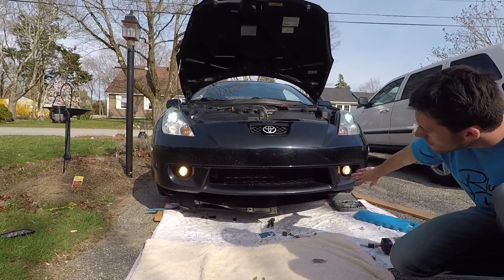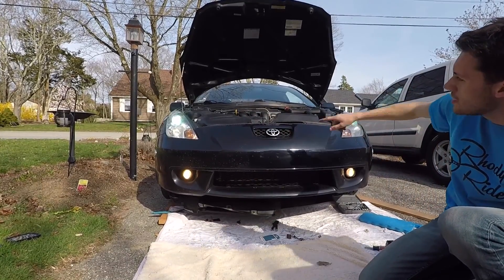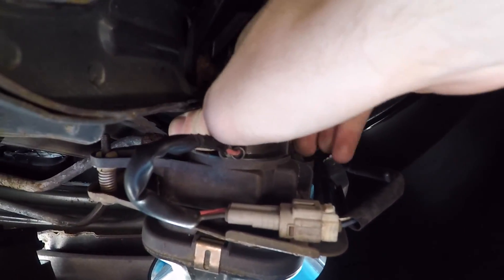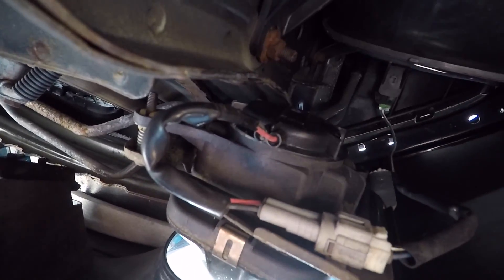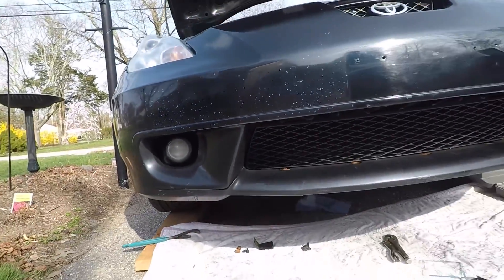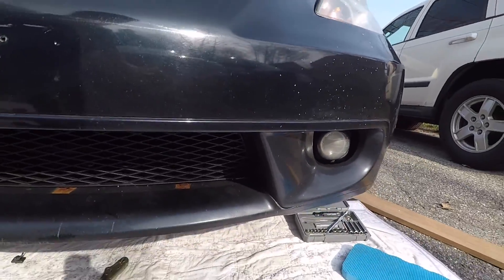You can see both the driver's side and passenger side are new and they contrast the HIDs pretty well, which was our goal. Put the cap back on, righty-tighty, and it twists right back into place. The last step is putting the plastic back up — pins break and screws rust, but you guys can figure it out. That is essentially it — fog light install on a 2000 Toyota Celica. I hope that was easy to follow. If you have issues with fog lights, that's how to fix it. Make sure to like, share, comment, and subscribe, and I'll see you guys next time!